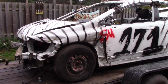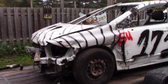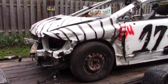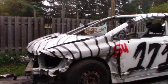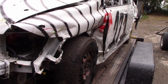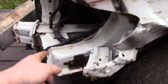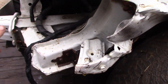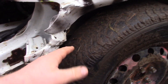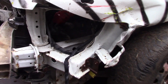The two-door one still runs, but he broke all of his steering, so his tires are kind of flopping all over the place. This one doesn't run, but it did something kind of weird that I don't really know how to diagnose. I do want to run it again because I was actually kind of impressed with this car in bone stock. You can see the fenders pushed in, struts straight, tie rods straight, the car still runs and drives straight. I might cut it here just to get that out of the way of the tire, because I think it's designed in a fender bender to bend into the tire to stop you — which kind of sucks because that's actually a half decent amount of steel I'm going to be cutting out.